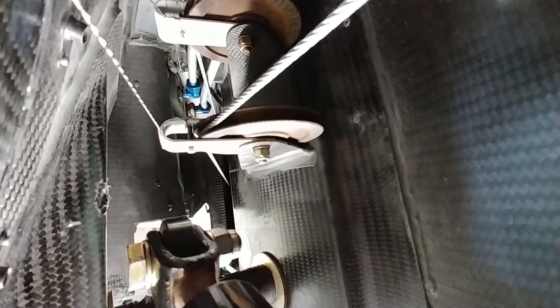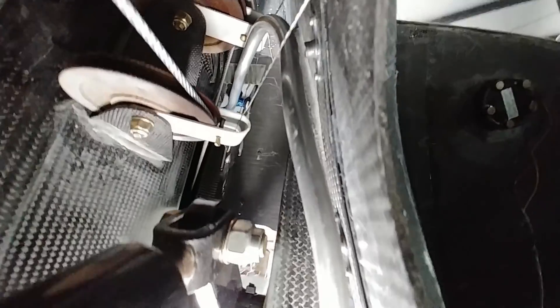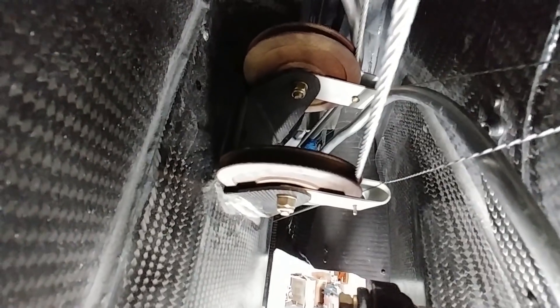Welcome back. This time I'm getting on with the job of securing these cable guards. I've got safety wire pulling in two different directions on these, and just created an anchor point on either side so they can't move left or right anymore. A little bit tricky getting in there to get access to do that, and there's the one on the other side — same type of thing. I drilled a hole there in that back bulkhead for anchor point one, and then put the safety wire around the elbow there for the fuel breather tank or breather line.